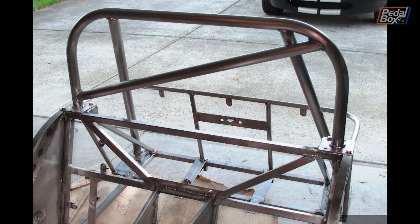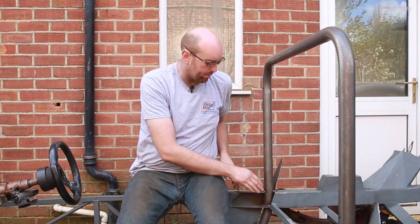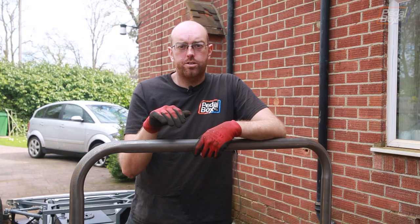Now the main hoop's fully welded in and the extensions at the bottom are welded in, it's worth dealing with the elephant in the room: this is not an MSA approved or certified roll cage. However, we are heavily working off their guidelines for the materials and design to give this some semblance of structure and safety. On a kit car, as you can see in this picture, the cage bolts or welds onto the top of the suspension turret — we've removed the inch box section below that and replaced it with inch and three-quarter tube, which is arguably a bit stronger than a standard kit car chassis. We're still mounting onto the single strongest part of our chassis, we're still going to use a mandatory diagonal member from the driver's side down to the passenger side, and the same type of tubing to go from here back to the rear struts.